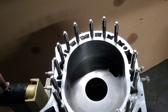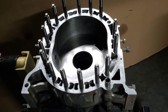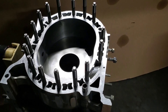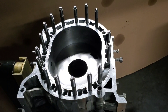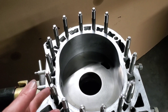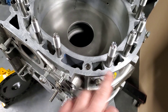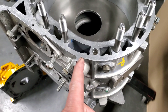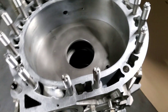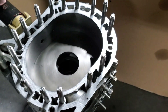So if you're running an OEM application, general rebuild, or mild performance rebuild, OEM tension bolt replacement with OEM-size studs is a nice thing to do. But at KMR, we push the limits — we build extreme motors: three rotors, four rotors, 13Bs. What we have found is the half-inch or oversized studding technique, which requires the whole block to be milled or bored through each tension bolt hole to a precision fit for the stud, because you're not just replacing the hardware.